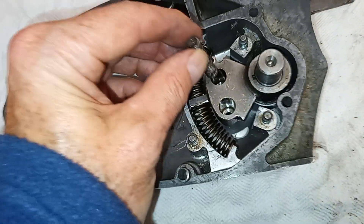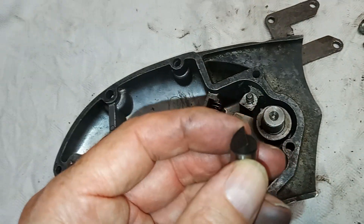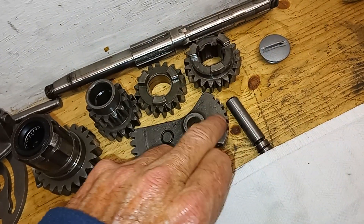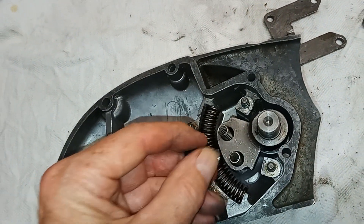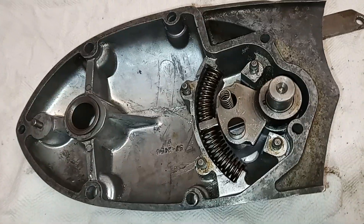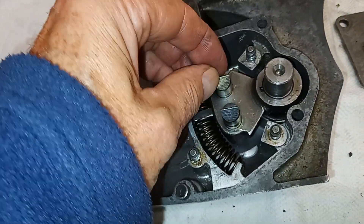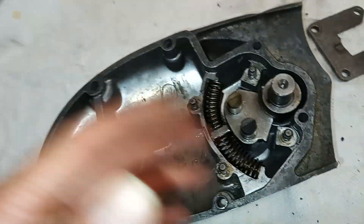Then we've got these plunger springs that go in the plunger holes, and then we have the actual plungers. I replace these because they've got nice new sharp teeth that will engage with the teeth on the butterfly quadrant. So it's good to replace them to get a nice positive engagement. I'll put some lube on and they simply slide in. The plungers are in, just sitting on those springs — replacing the springs and plungers helps give a very positive gear change because the springs can simply get tired and everything becomes a bit vague.